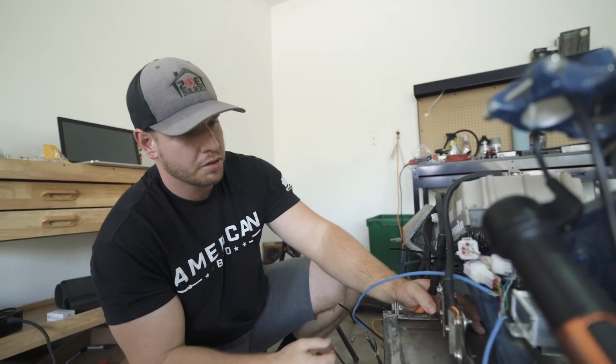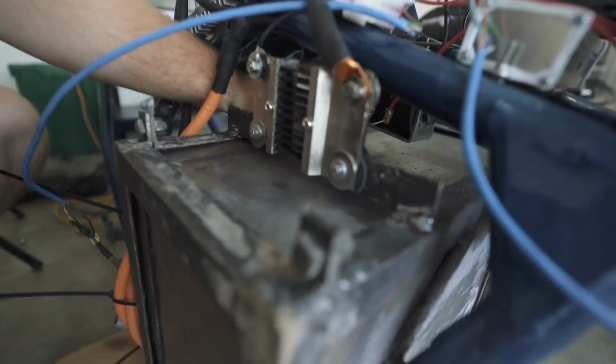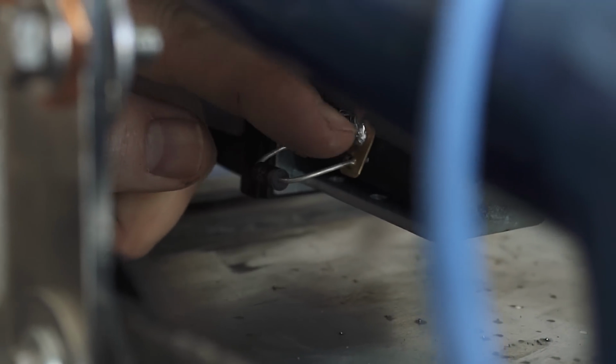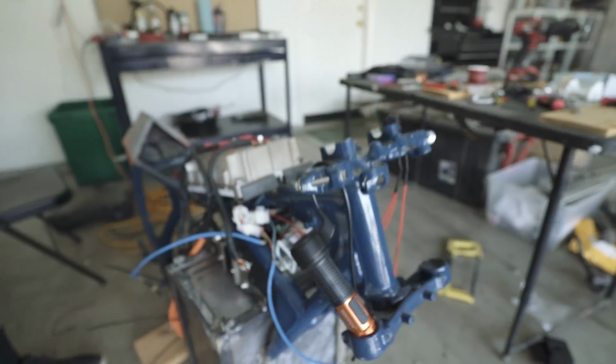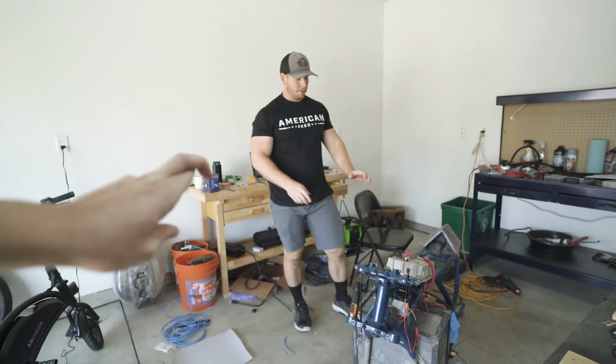Makes sense, yeah. We also did have a diode across these contacts here, just per the diagram. Oh, yeah, I see it. Yeah, Kelly sends them with their controllers. So you just put the negative end of the diode attached to the positive end of this ignition switch. So it should all work. Theoretically, we plug it in, nothing should blow up, and we should have the ability to start programming.